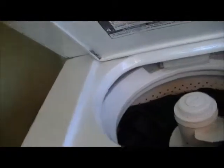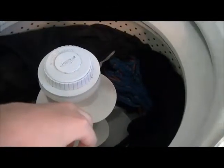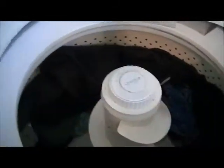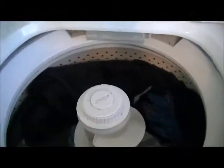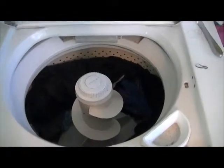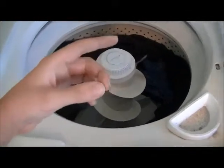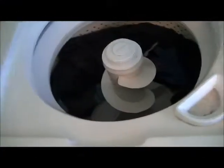The motor will drive the pump and force the water back up into the tub, and the agitator shaft oscillates because there's another gear, a small gear on top. It's next to the spin gear wheel.